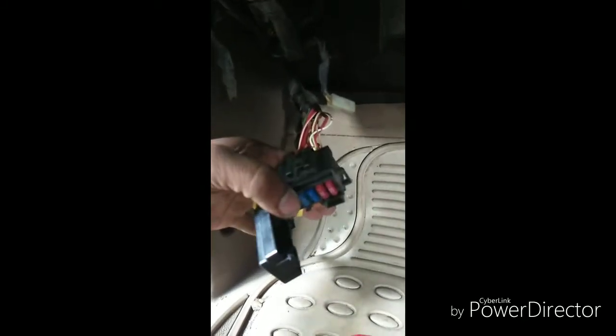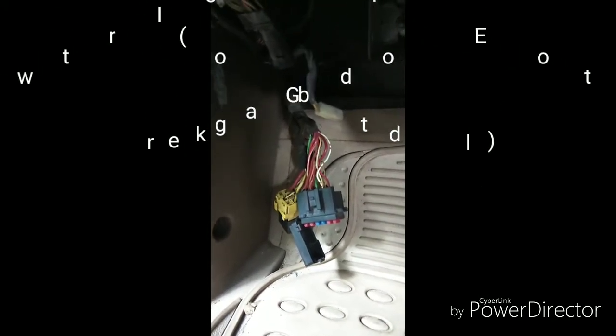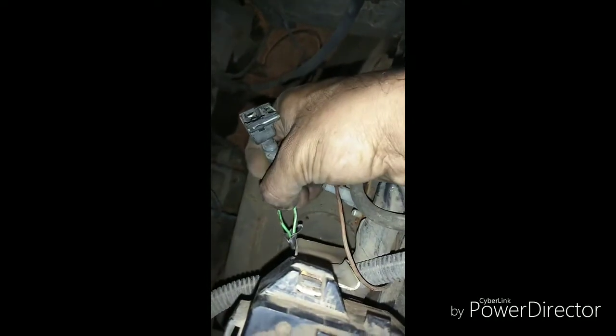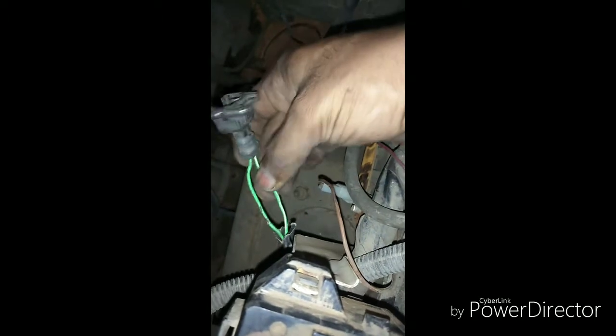The circuit diagram says that this fuse activates the stop lights as well as the EGR modulator. I'm going to remove this modulator — here is the wiring to the modulator. You can see it may have been shorting to ground, and that's the reason why it was blowing the fuse. So I've just left it out. The check engine light will be on because it will trip an EGR error.